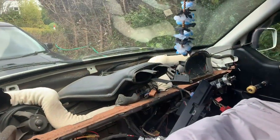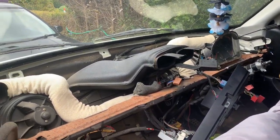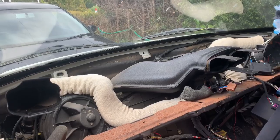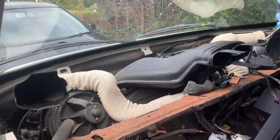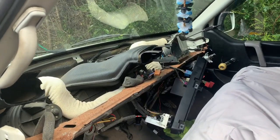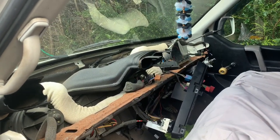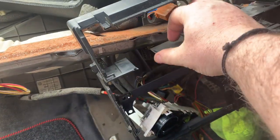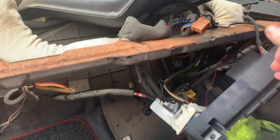This is my bay as well behind here, so you can see I'm a VW man. Today's job has been removing the dash from my T4. Here we are, dashboard removed. It was a bit of a pig of a job because I didn't read — or at least I missed — the section that told you about that bolt just there inside the bonnet. So I was heaving away and nothing would happen, but eventually I rechecked and that's the one. All in all it's a pretty easy job. The problem I've had with mine is some stuff broke, namely the clips here where the centre vents are. But anyway, it's the dash.